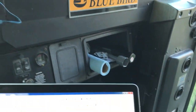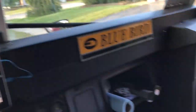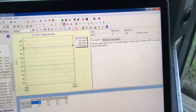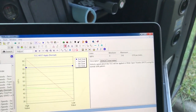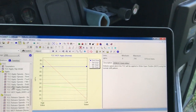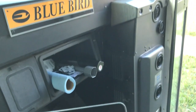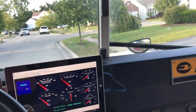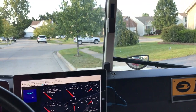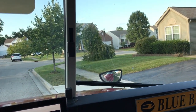This video is about transmission tuning I've been doing a lot of the last couple days, trying to get this dialed in exactly the way I want with the actual transmission control module. That allows me to reprogram it — so I can control my lockup and shift points. The problem I had was in fourth gear when I had the bus floored, the transmission would unlock the torque converter, which shouldn't happen.